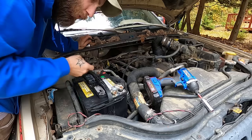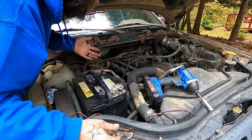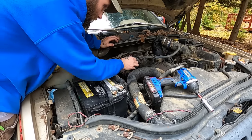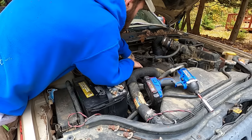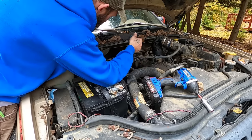Those iridiums are great, but this engine was not designed to run on them. So leave that crap in your brand-new Subaru, your brand-new Dodge Challenger. Your old 4-liter? It wants the coppers. Now one of the biggest bummers about the newer 4-liters is this coil rail. It makes changing your spark plugs a little more annoying. And also, if one of your coils fail, they all fail. I'm not a fan of it.